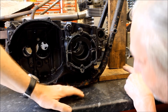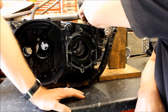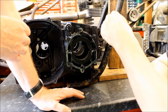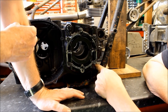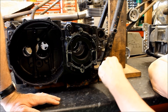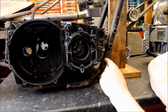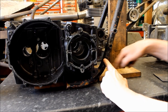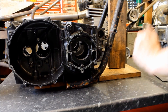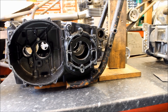Can we see where the original mounts are going to be? The top one — if we look through — the original Z650 lug is in line, but it's only a 10mm hole. We could cut that off and make a new boss for it, using bigger 12mm bolts. These mounts will all have to be removed and cut. I was studying this and considering we've got to make two slugs to join the frame, we might as well make two new loops and join it here — which means we don't have to worry about cutting all these brackets off. Once that's joined we can actually weld a tube across to brace and stiffen it. We can use the original mounts with a new plate and weld a new 12mm lug for the new engine bolt, making spacers accordingly to suit.